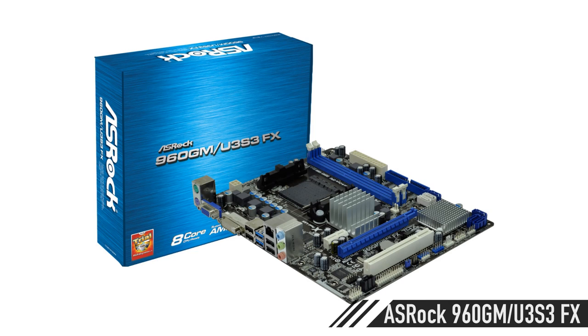For the motherboard, I grabbed the ASRock 960GM/U3S3. That's a micro ATX board with USB 3 on the back, which is nice. There's no USB 3 on board, so we're just going to get a regular case with USB 2 front panel connectors. I also like that it has a variety of expansion slots: a PCIe 1x slot good for sound cards and controllers, a 16x slot for your graphics card, and a legacy PCI slot, making it past-proof.